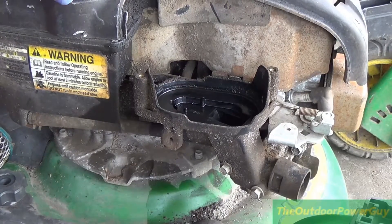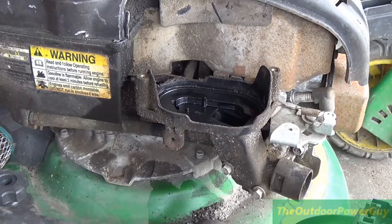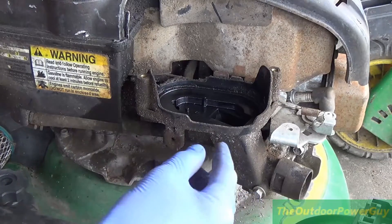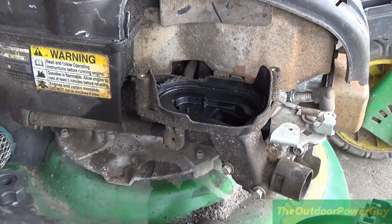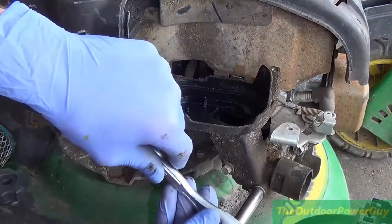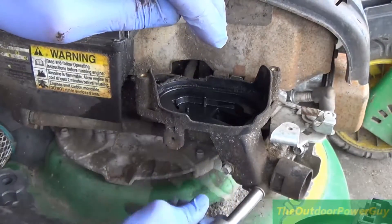This is a project that I started on. As you see, it's been leaking gas — I don't think there's anything left in the tank. It's kind of rotten, but this one here I've got to take the whole carburetor off of. We've got two bolts here that take this air box off, and they are a 5/16th. There's no gas in the line, so whatever is in there can graciously drain out.